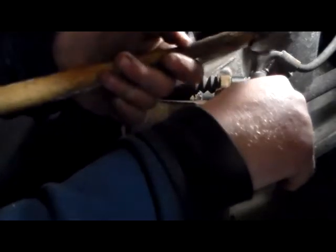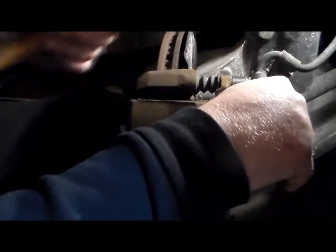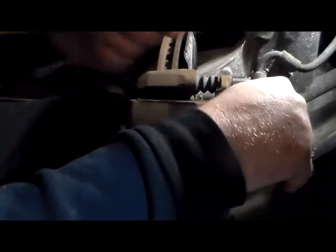I would say it's from previous owners. What you want to do is put your ratchet on there like so, and just take your handle to your hammer. You don't have to use the actual metal part — I don't like damaging tools, so I always use the wood part. I'd rather break the handle than break anything else. Take that and loosen that bolt up.